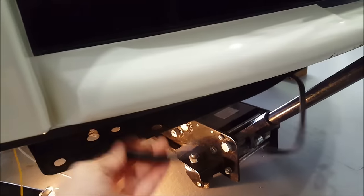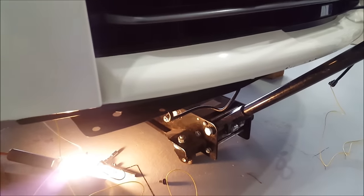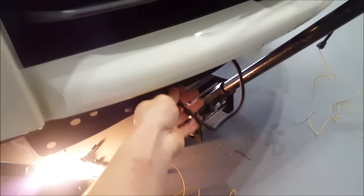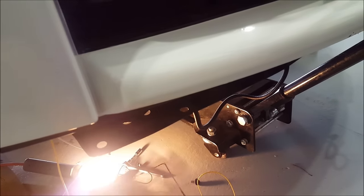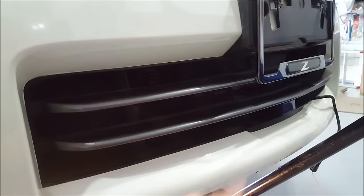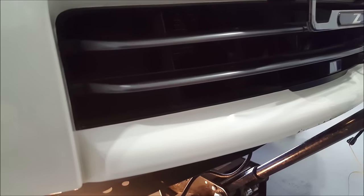For the driver side harness, the nice thing about this kit is they give you enough length to do the whole car — you don't have to make your own harnessing. For the driver side harness, you want to loosen this shield or remove it altogether, and you'll find another factory harness in here. You can attach to that and do your run to the other side — that way it's going to look nice, be secure, and nothing will move around while you're driving.